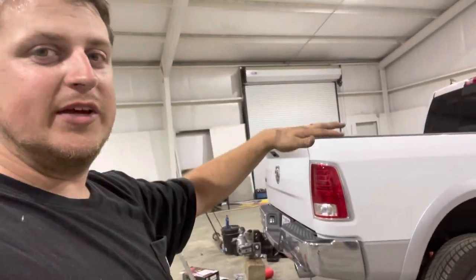So we got the driver's side in — you guys saw me struggle from the outside. I'm going to set the time-lapse up underneath so you can see how I get it in there. Basically I get it squished down as much as I can and zip tie it a whole bunch of places to keep it smooshed down. The truck is jacked up by the hitch so the suspension droops down as much as possible, making that coil spring spread out and create bigger gaps between the springs. I start not at the very bottom but one row up, put it in and fish it up. The reason I don't start at the bottom is so I can reach my other hand from the bottom to help guide it up. Hopefully that helps — it seems impossible, but it's definitely not.